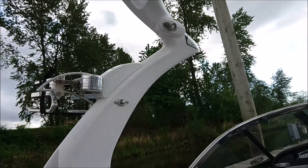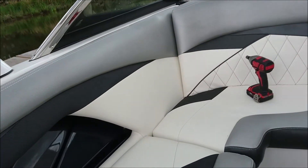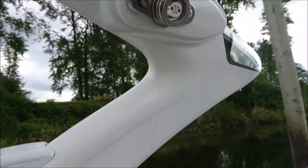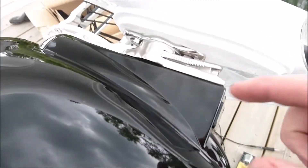At this point, look at the pins — line the pins up on the speaker. They'll only fit one way. You will see a notch right here, and then you will see a notch right there on the white part. Slip that notch into that notch and then put the fork in.